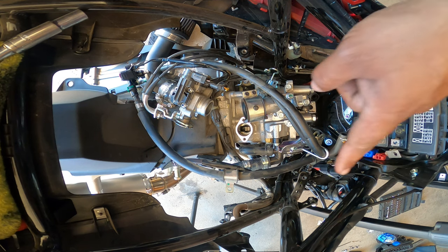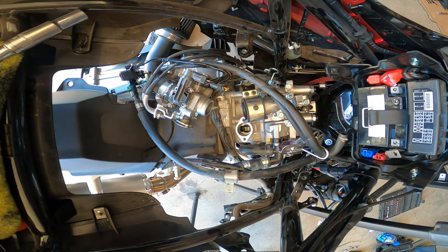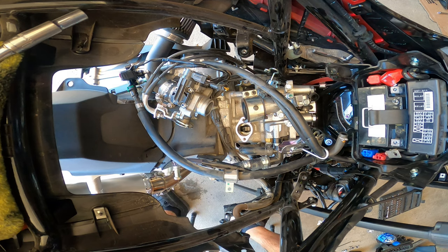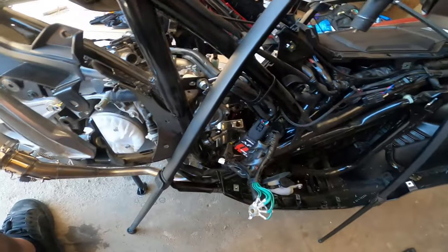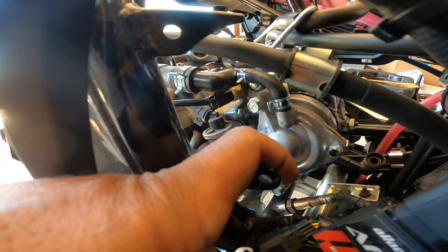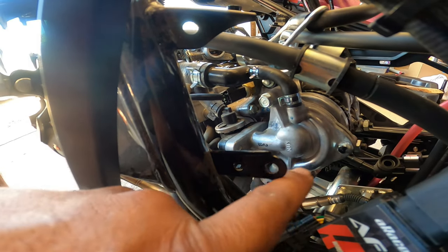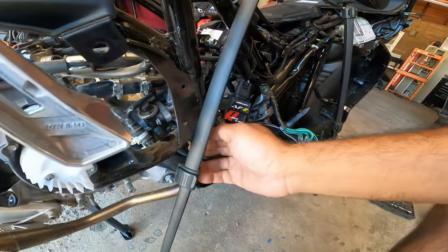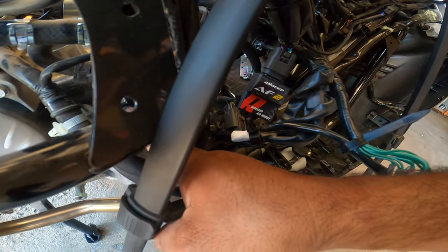The next step is to take the water pump housing off, which is on the other side. And it's right here. So what you need to do is take off this line right here, just pinch and pull. There's a 10, 10, three 10s right there, and an 8. Those three come off, and it should, let's see, nope, that's not gonna take everything off. We still have, let's see, this lower radiator hose is detached already, and the other hose is detached.